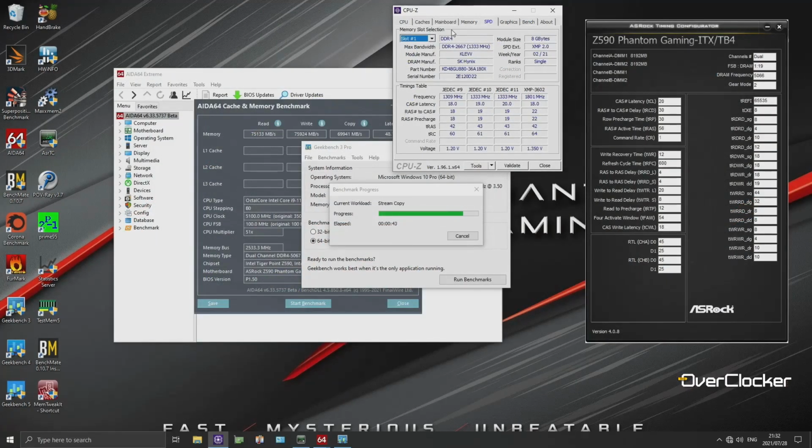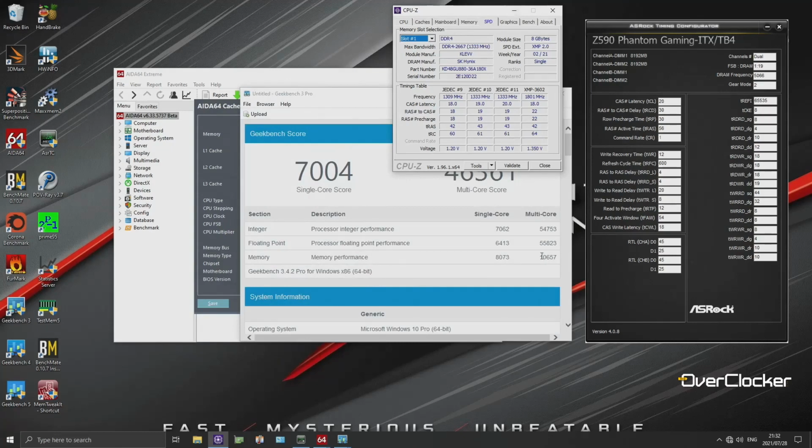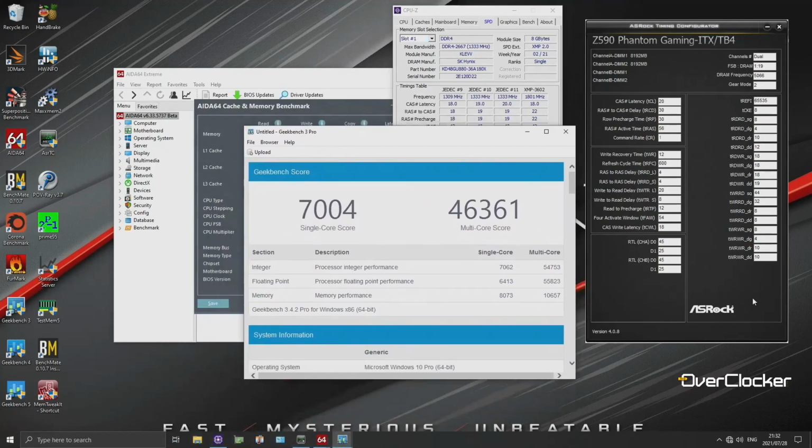However, the interesting thing about this memory is that it now presents you with options that you generally didn't have prior to us getting 12th gen, perhaps even 11th gen. Because with 10th gen CPUs and you buy something like this, you're just gonna go for max clocks, tightest timings, and that's it. You don't have to worry about gearing and so forth.